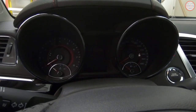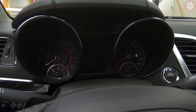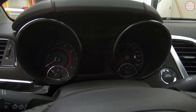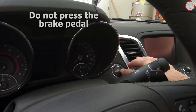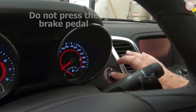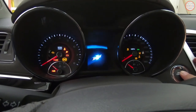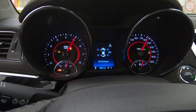To initiate the TPMS sensor matching process or the TPMS ReLearn Procedure, you need to put the vehicle into service only mode, which is using the engine start/stop button but not starting the engine. So we will depress the engine start/stop button for approximately 5 or more seconds. It will say 'apply brake to start' but we need to wait beyond that, and now the entire instrument panel is coming up like it should.